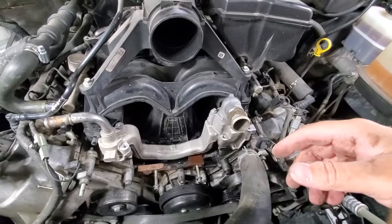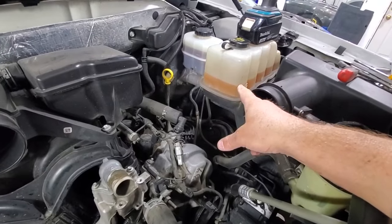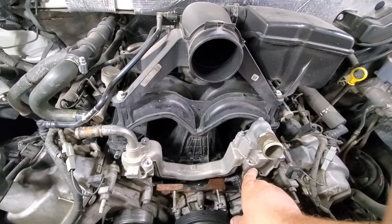Symptoms: obviously a 5.4 liter 3-valve started having a coolant leak. The reservoir itself — I started noticing the fluid level was actually down. Came back in here, started diagnosing it, actually pressurized the coolant system. Sure enough, the gasket under this side.